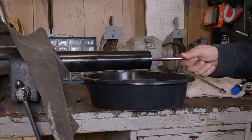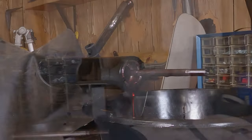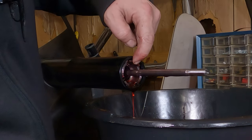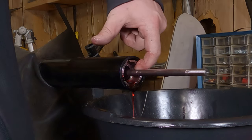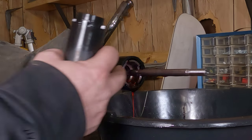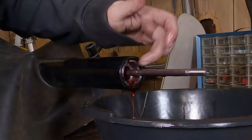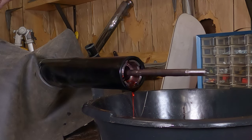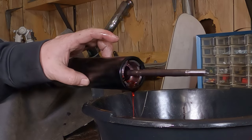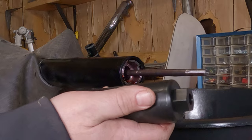So right here, there's what looks like a little castle nut — almost looks like a chess piece. What that is is holding the whole valve assembly down in there, and there's a spring underneath it. Now you probably could take a hammer and punch and drive the thing out of there, but you're going to damage that nut, and God forbid you damage the threads on the inside of this fork — you're buying a new fork. So this is where the special tool comes in.